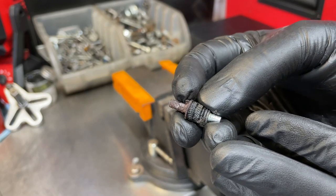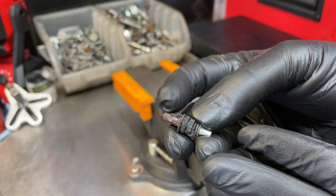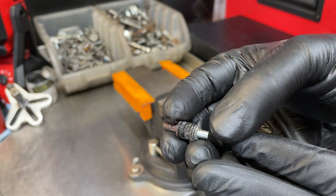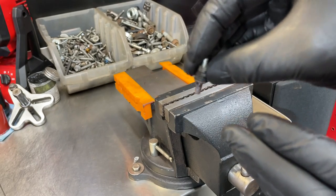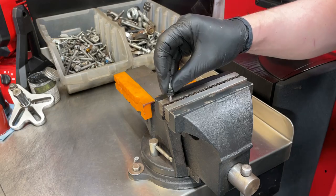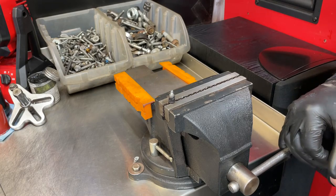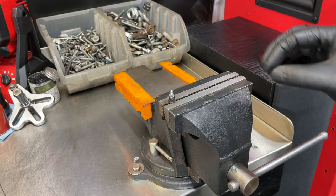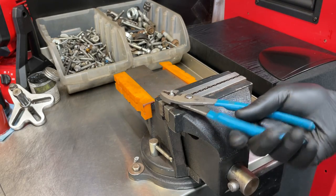What you want to do is take the broken rusted part and stick that in the vise — not the insert. The insert is brass, a soft metal, and sticking it in the vise will distort it. We're trying to work it this way to save the threads, so we don't want to ruin them. We're going to flip it over and stick the broken bolt end in the vise. Just remember this insert is going to be hot. We're going to take a standard slip joint pliers and loosen it.